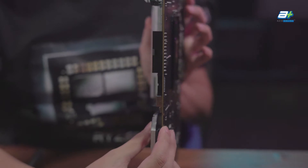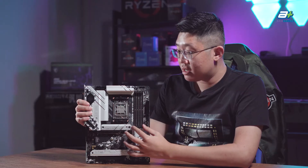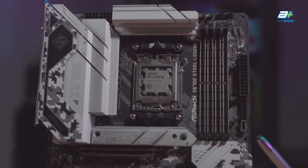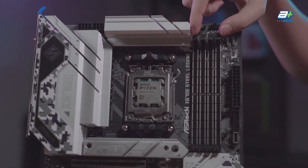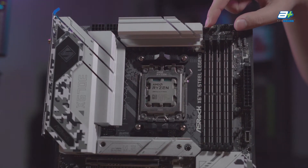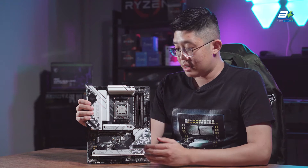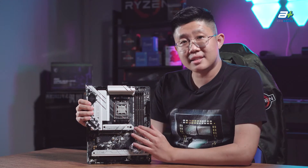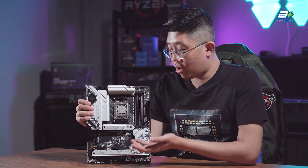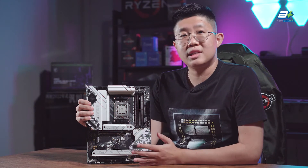You can be quite sure that you can slot in a Ryzen 9 7950X and this board will run it without a hitch. Moving on to memory — the Steel Legend has 4 DIMM slots and can support a maximum of 128GB of memory, with memory overclock speeds of up to 6600MHz. It supports the new AMD RAM standard EXPO, as well as XMP for RAM kits without EXPO certification. A noteworthy addition is that it supports ECC DDR5 memory, so for anyone looking for more stability or wanting to turn their home PC into a mini server, this might be the board to consider.